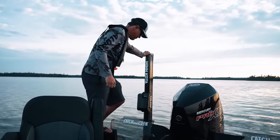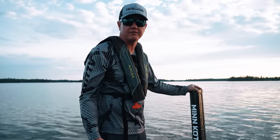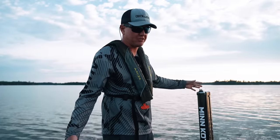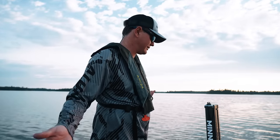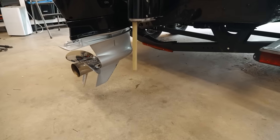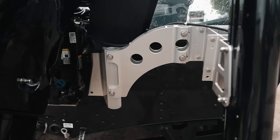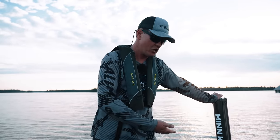The Talon was another upgrade from last time. I went from a 12-foot to the 15-foot Talon — the biggest size Minn Kota makes. The reason I went with a Talon instead of a Raptor or Power Pole is the top here is one of my favorite filming angles. I JB welded a GoPro mount on top — it captures the entire boat, nice and wide. The 15-foot Talon is a fiberglass arm that sticks down 15 feet, anchoring effectively in about 12 to 13 feet depending on the bottom. I have a sandwich bracket and a spacer bracket on the back, and one Talon has been plenty for this boat.